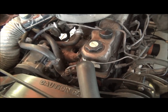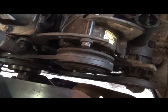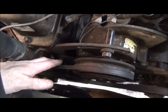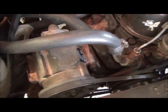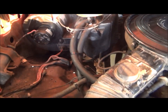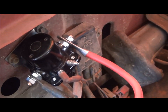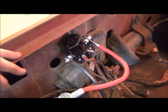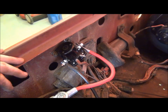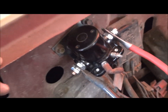Welcome back — we've finished the install of the water pump and I also installed the thermostat. You can see I've got all the belts back on and tightened up very well. You don't want to over-tighten those belts — too tight and you can wear out bearings and the belts prematurely. Got all the hoses back on with the breather and everything going back to the heater coil. Also replaced the solenoid, and you want to be careful not to mix up these wires here — mixing them up can cause malfunction of a lot of parts and can get you hurt.